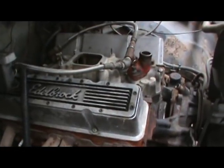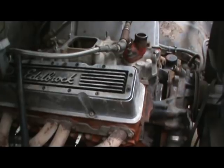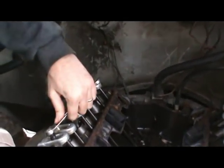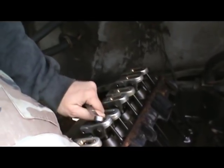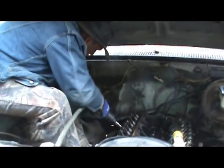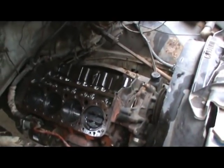What I'm going to do is pull this intake off here, pull these valve covers off, get those plugs out of the block, get my headers off, and pull those heads. I went ahead and popped that intake off and right now I just loosened the locks — they've got an Allen head up in there, which was common for the roller rockers the way they fastened it down. Once you get the pressure off the valve spring they come off pretty easy. I'm going ahead and getting all these adjusters off and putting them in a box, and I'll do the same thing with the roller rockers. Rob's helping me out here — he's taking the head bolts out for me. There she is, fellas, stripped down. I went ahead and shot some WD-40 in there and got the cylinders all cleaned out and took a shot to the lifter valley and cleaned it up a little bit.